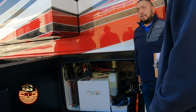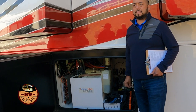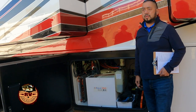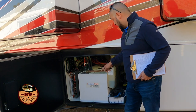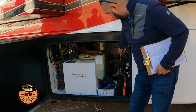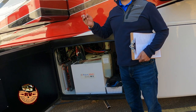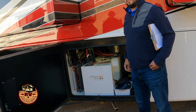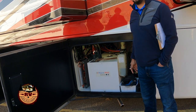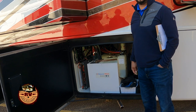And how easy is one of those things to push in? That's got stuck in almost New Mexico, one of the air modules. Right. Well, that's the first step, is to release the air on the bladder. Second step is on the hydraulic pump, you want to release that solenoid. Yeah. But what it did was, it released, and it never hit the limit switch where it showed enough vacuum on the bladders all the way down. Okay, there's a bypass for that too.